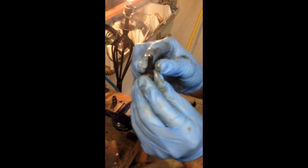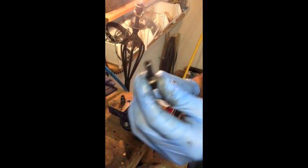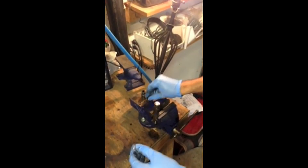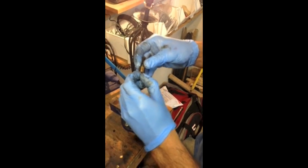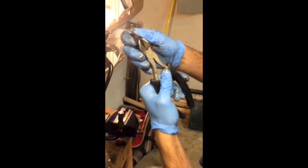These are 0.184mm holes in your injector — that's the stock orifice size. There's a little pin in this nozzle. You take that, give it a little tap. Grab some side cutters, grab it lightly. That is your plunger. Now you don't want to lose that, damage that, or scratch that. Put it on a rag somewhere safe.